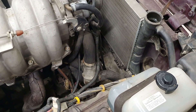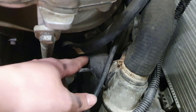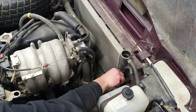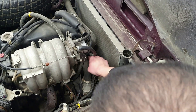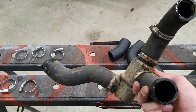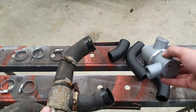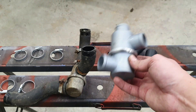The coolant is pretty much drained. Now we need to loosen this shell, remove this, and follow the thermostat to find everything — we need to remove one more down there. Now we just need to take all this out. The old one is out and it looks nasty. When you compare it to the new one, it's awesome. Now it's time to put these three hoses like the old one — you just need to copy everything and make it nice.